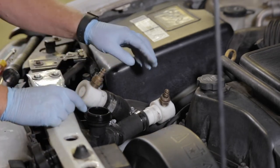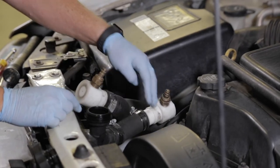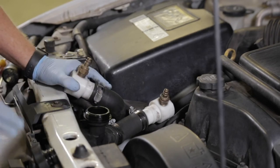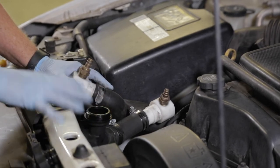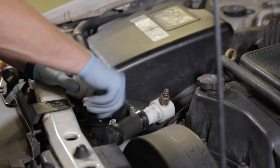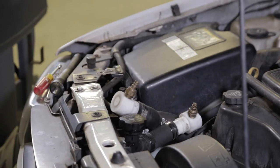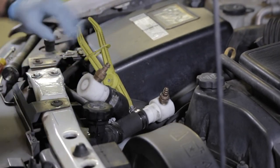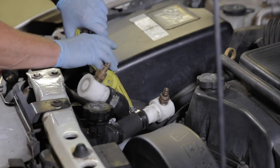So now what we have is access to the engine through the upper hose past the thermostat, and access to the radiator through the upper radiator hose connection. Now that we've switched these over, it's a good idea when you start out doing a cooling system swap to go ahead and top this off with water — that's better than having big air pockets inside the system. When we start to flush, it's a good idea to have a full system, so we would top this off with water and put the radiator cap back on. I did miss one step that is pretty handy: if you use these pliers when you're taking the upper radiator hose off, clamp it off first before you take it off the car, then you won't lose so much coolant, as coolant sometimes comes out of the upper radiator hose as well.